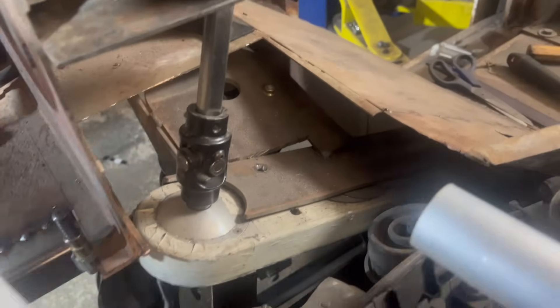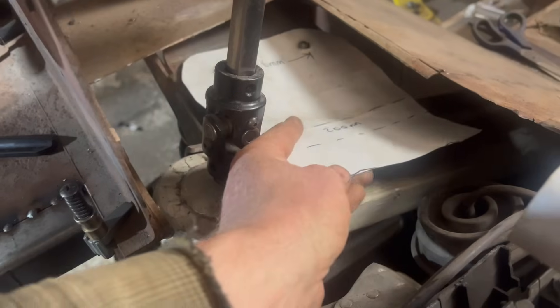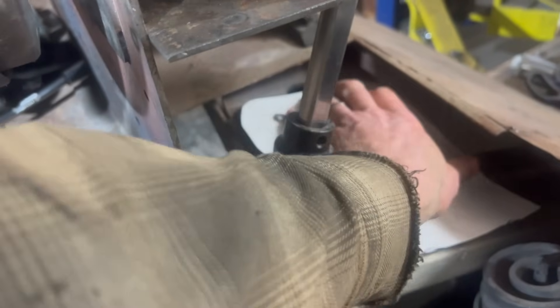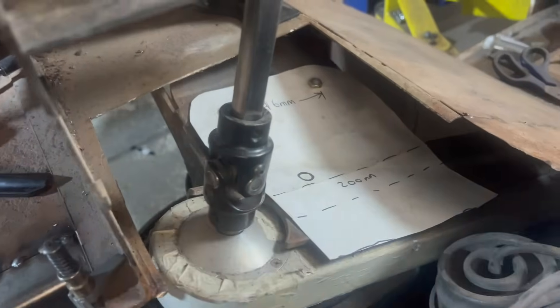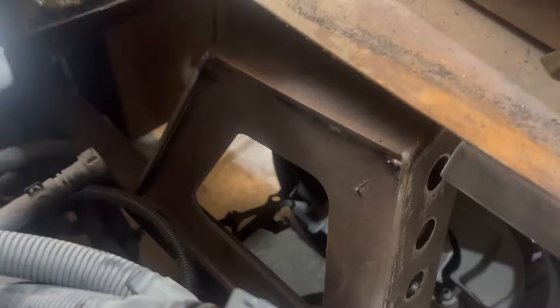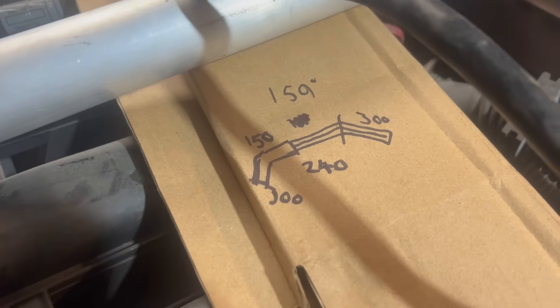Next tricky task is to make a strut brace. I need to get a little bit of rigidity into the top of this chassis, so I've made a little cardboard template — feed that in, and it will take up two of the strut bolts. This hole here will be the one that goes through the steering deflection box. I'm going to cut that on the plasma out of 5mm steel, mirror it onto the other side with a right angle fold down here, and I've also popped a bit of tube on top. I've used my angle finder to take measurements, work out some angles, and made a very technical drawing.